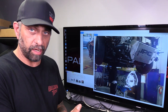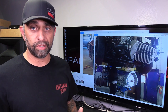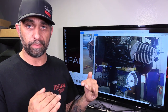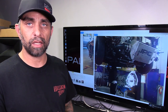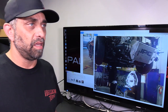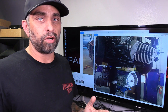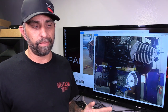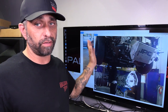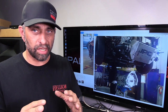Here are the quick bullet points on air-to-air versus air-to-water. Air-to-air: absolutely cheaper, less complicated, and more than enough for most power levels — it's a sliding scale. Let's say you're making 700–800 horsepower: air-to-air is probably fine. I'm a huge air-to-water guy — I was involved in designing the kit on my car — but I'm a little less hardcore about it now. After going to the track and seeing setups like Sandra's air-to-air car, it's so nice not having to stop for ice or drain water.